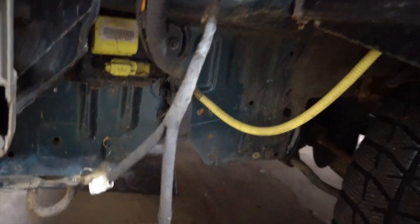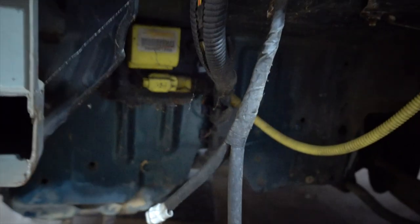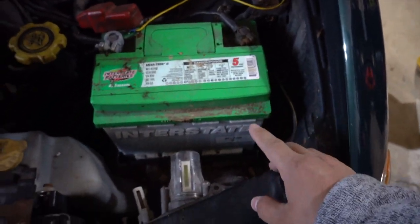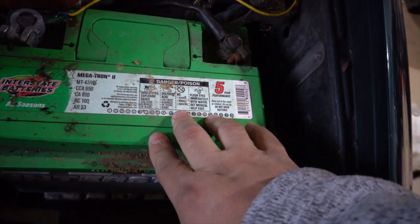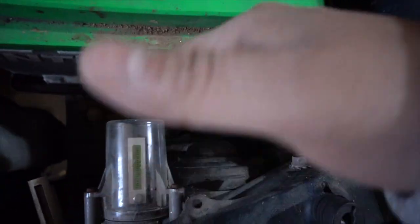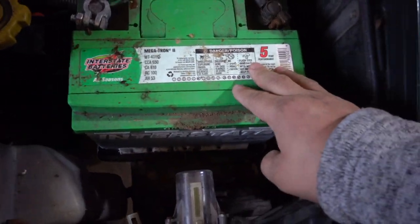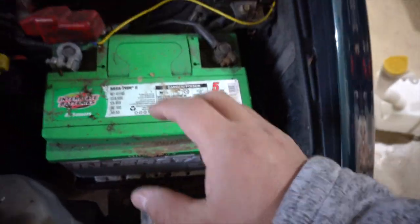What I'm gonna do is take this airbag sensor off and move it to the side for now. Then I'm gonna remove this battery. This battery is also gonna get moved to the trunk. So basically I'm gonna have this whole area free. But just in case I do have to keep a battery here, I kinda wanna open the hole closer to the end here than to the battery, just in case I have to put this back. So we'll move this, I'll mark it up as far back as it goes, and then we will see where we can open the hole for the filler neck.